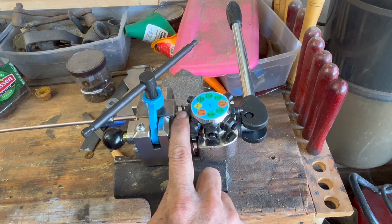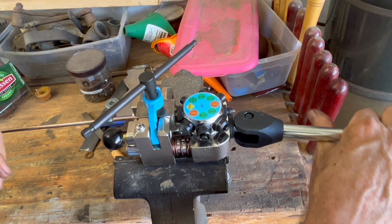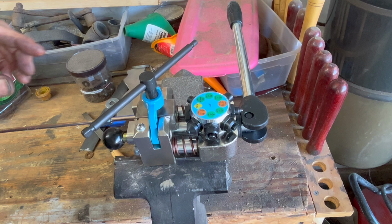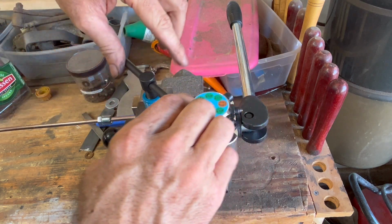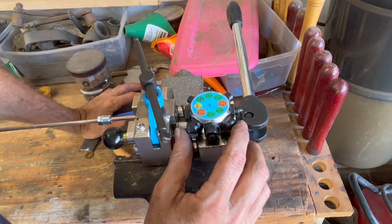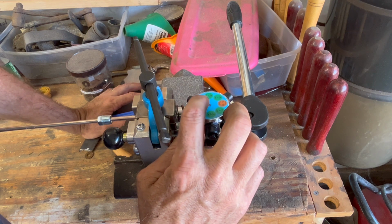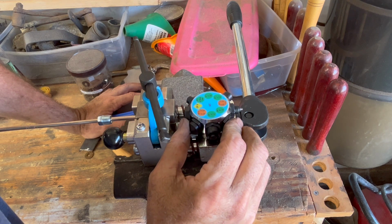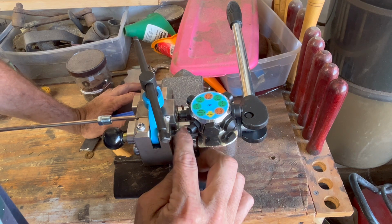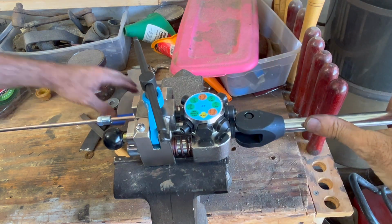So you have this little flat punch, and when you pull it, it slides the line to the spot that it's supposed to be. Now once it's there, I'm going to tighten this down because I don't want it to move. And I'm going to do a flare, and this is a 2-step process. On the top up here, there's operation 1 for 3/16. So I put it there, and it's lined up, and once I pull,